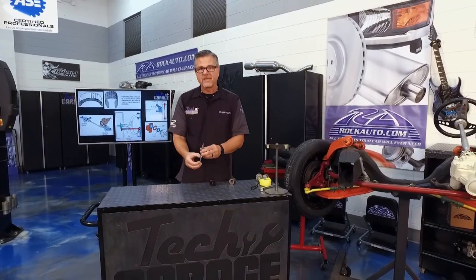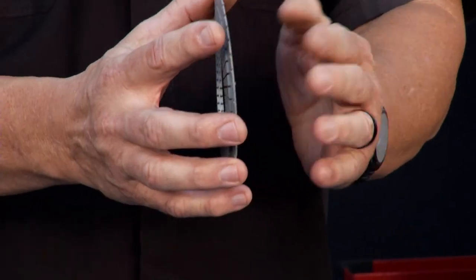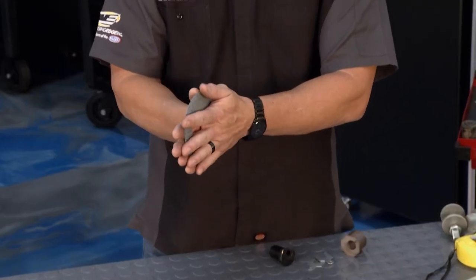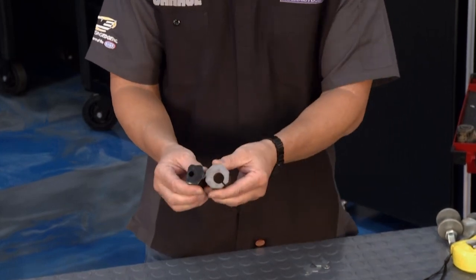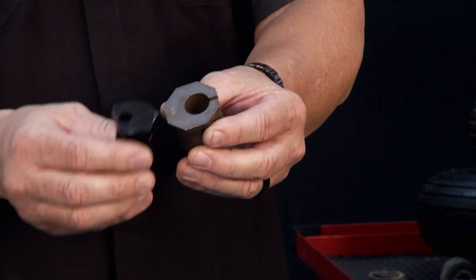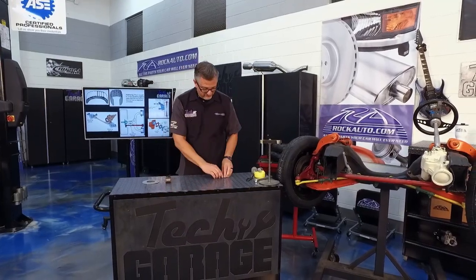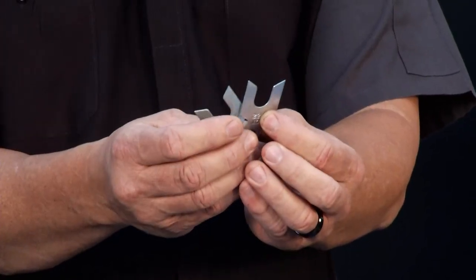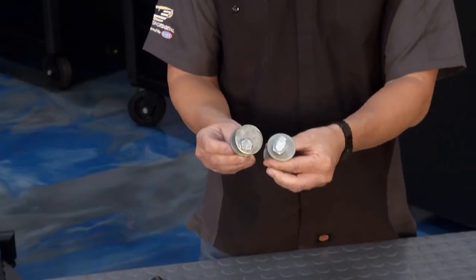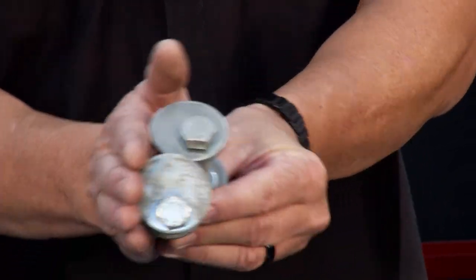A couple of adjustments: you can have a shim like this — it's thick on one side and thin on the other. Put that between a hub and factor in a 16-17 inch wheel and you're really moving that hub in or out, affecting the alignment angles. These are offset ball joints — asymmetrical — so when you turn them, the spindle moves and you affect the alignment angles. You can also use shims in control arms for caster and camber, and sometimes toe. You also have these eccentrics — off-center and asymmetrical — pushing against the control arm to move it in and out for caster and camber on a lot of systems.